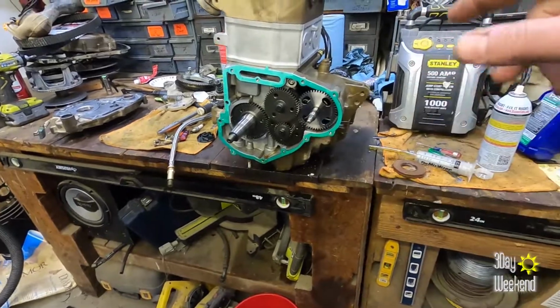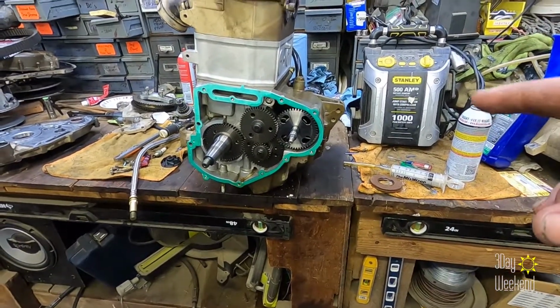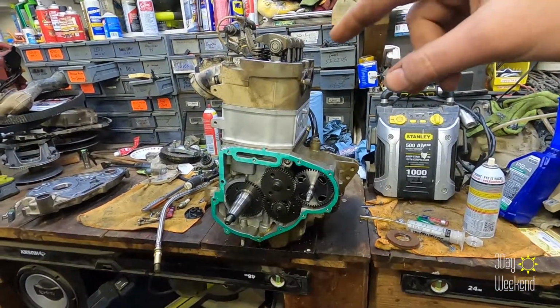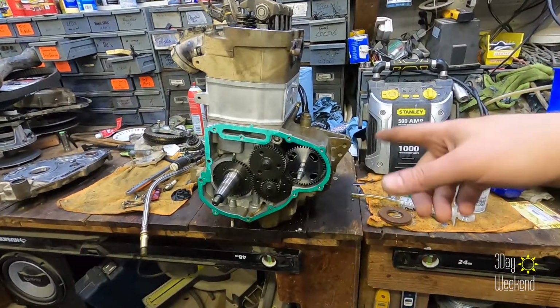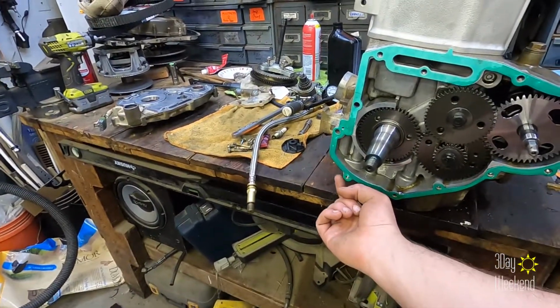But we did prime the oil pump. We have good oil pressure. Got that all going. And then we were low on compression, but that's just because hydraulic lifters just need more oil pressure for that. So I think everything is good mechanically. It turns over, you know, we hit it with the starter, everything sounds good. But then it started leaking oil from the bottom.